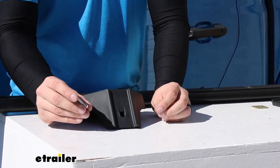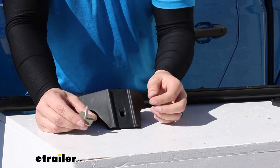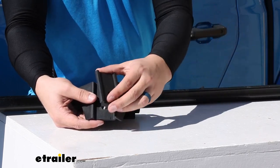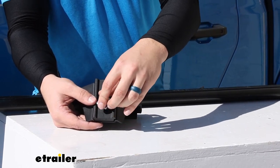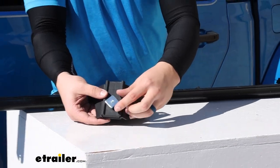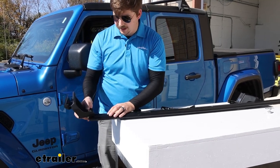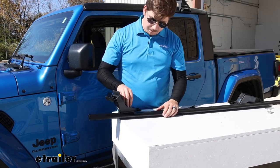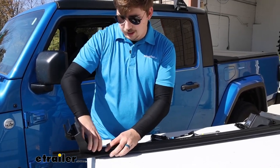Our adapters include a long bolt, a lock washer, and a larger square washer that's a goldish color. You can feed that from underneath up through the top. On top, we add our plastic adapter piece as well as our T-bolt — just thread that on loosely. This is what's going to sit in the channel of the Aero Bar. Then we come to the end of our crossbars and install these. We've already got the crossbar flipped upside down with the end caps off — that just slides in place with the actual clamp facing the outside. Tighten that up by hand for now, enough that it can still move around but won't shift too much on its own.